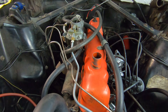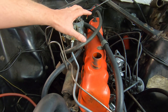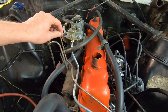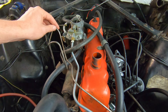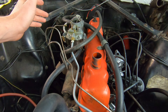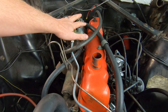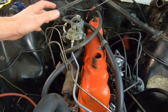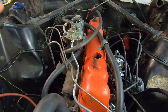The way this works is: as your RPMs go up, the manifold vacuum inside your engine goes down because you have atmospheric pressure rushing into the engine. So your manifold vacuum drops and your vacuum signal becomes too weak to provide adequate spark advance to advance your ignition timing. The way they handle this is with the spark control valve — as the manifold vacuum drops, the spark control valve closes and the carb switches over to a venturi or ported vacuum through internal passages in the carb. So as the engine runs faster and brings in more atmospheric pressure with less vacuum, it's still able to supply vacuum through your lines and advance your distributor. That's kind of the roundabout way how that works.